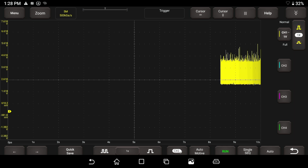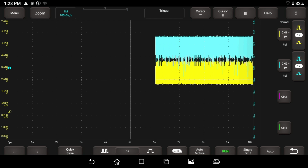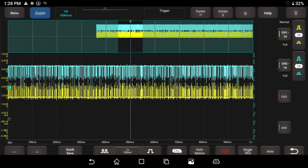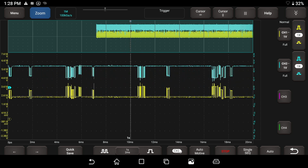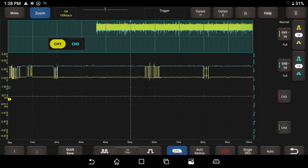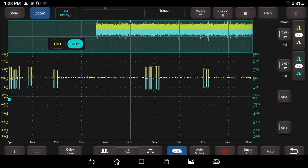I'm going to turn on channel 2. And let's go ahead and take a look at what we have. If we stop this and hit the zoom in button, and let's make this tighter, you can see we have some nice CAN packets here. I'm going to adjust the channels here. I want my channel 1 to be a little bit higher, and my channel 2 a little bit lower. And I'm sure you guys can tell that just messing around with the scope a little bit, I'm getting a little more comfortable with it, which is awesome.